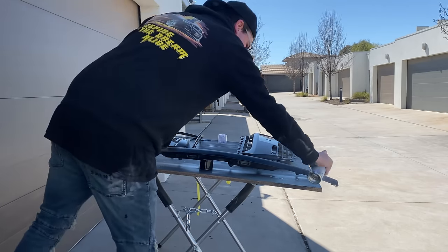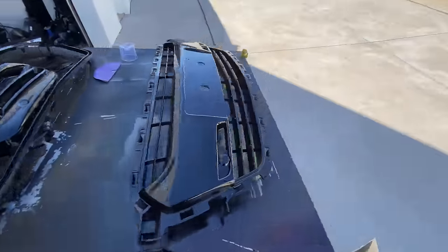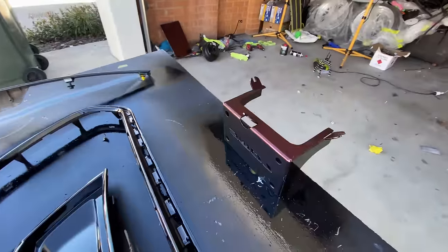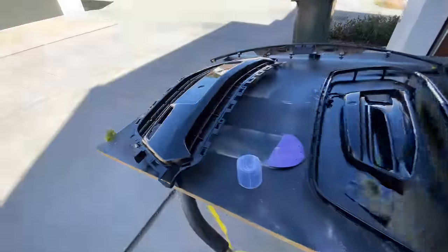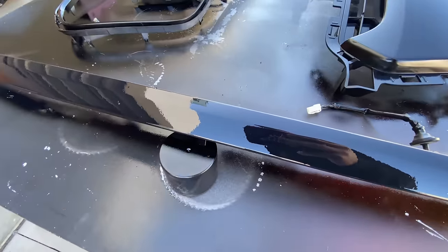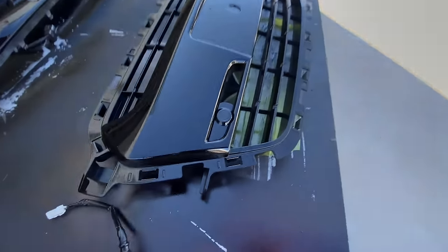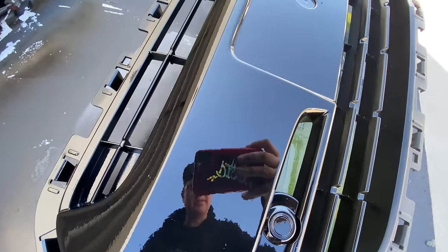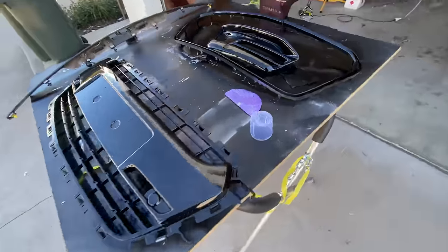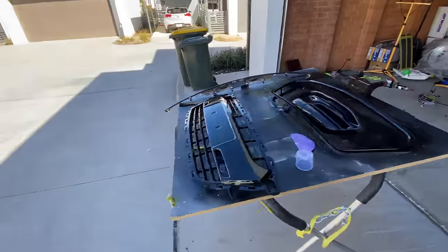I've done my third coat. The top bits are definitely done, probably the grill trim and the power steering mount too — all done. But the front trim piece — because of the design of the weave — looks like orange peel, kind of just filling in the tiny gaps. I might stack on one more heavy coat after this just so it's more glassy. These still look great as long as you keep that wet edge and really stack it on. Just find that fine line between a run and just having it clear.